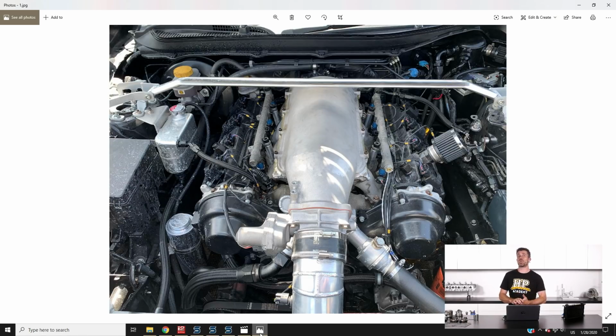So that's all been pretty good. We've got the usual oil coolers on gearbox and differential, considering we are competing in endurance races here. So that makes sure that the temperatures will stay under control. The issue that we've been constantly battling for the whole season is with our axle strength.